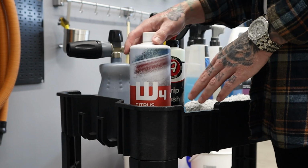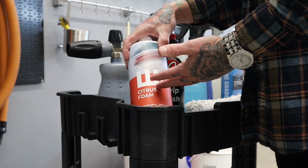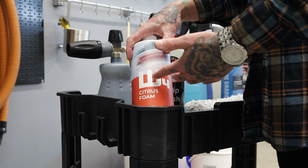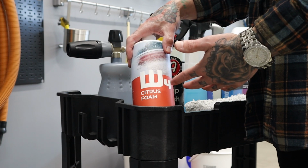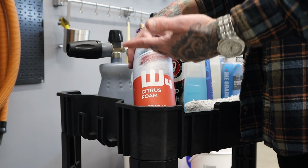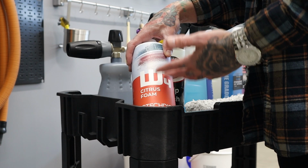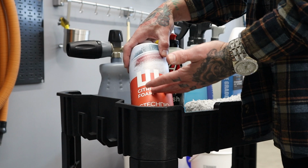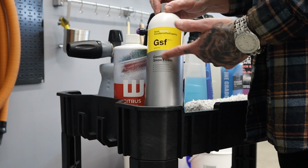I just didn't want to get two things complicated, but where I live right now, it's off and on raining, so you get that grime of the road. This will help reduce taking that off, and also help reduce scratching the actual paint when you're washing it. It's still pH neutral, but it won't hurt your waxes or your sealants or your coatings. So this is just a pre-wash stage, and then you still come back with a two-bucket wash method and all that type of stuff. This is for when your car is really grimy. If it's clean and nothing really bad, I would use that one.